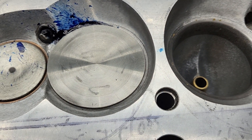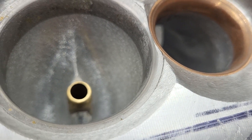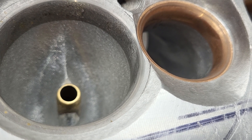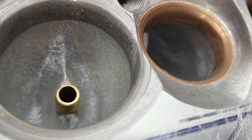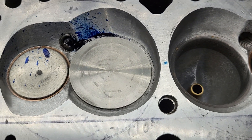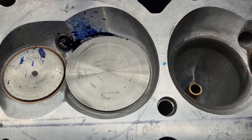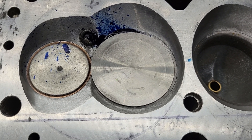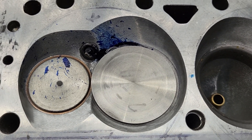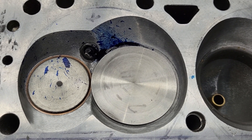In actuality, the valve DV sent me was a 2.25. You can see with that 2.25, it just makes it — it really just makes it. It's super difficult to get a decent valve job on it. But I did have to hone the guides in order to make them even straight enough to put a seat on it that I could check the runout. They should be good to go now. The valve job is completely usable. It is DV's specific valve job — less than a 45-degree seat. I won't say anything else about that.